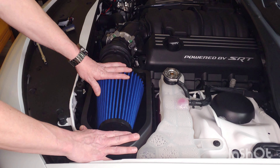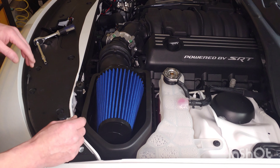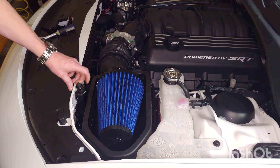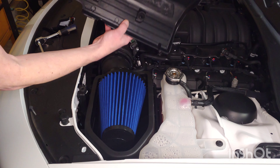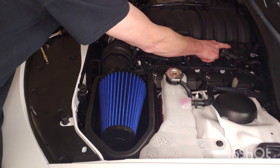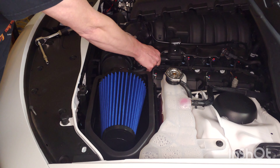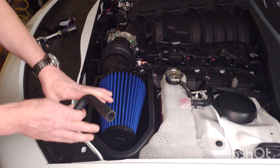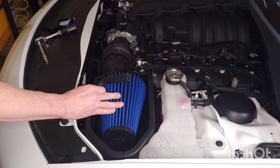I've already got the lower portion of this kit installed, but let's run through it quick and I'll show you how to do a quick disassembly — get your old one out and get the new one in. You have an 8mm hold-down bolt here, just an 8mm head. Once you get that out of the way, this just pops off — it's held on by these little pieces of rubber and these two stands. This is our PCV fresh intake tube, which allows fresh air to be drawn into the engine through the positive crankcase ventilation system, and eventually it dumps back into the intake.